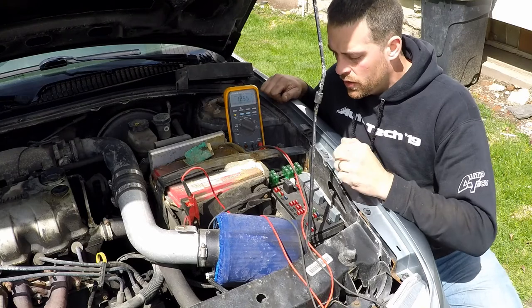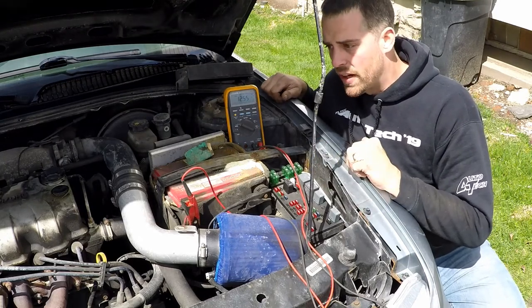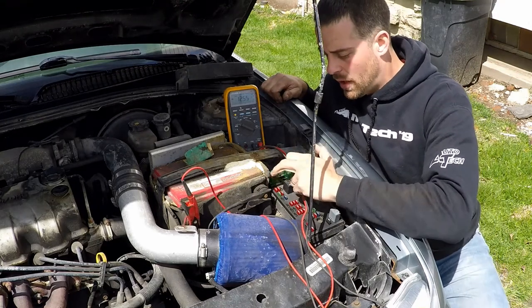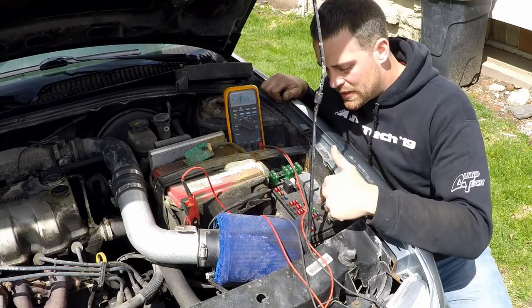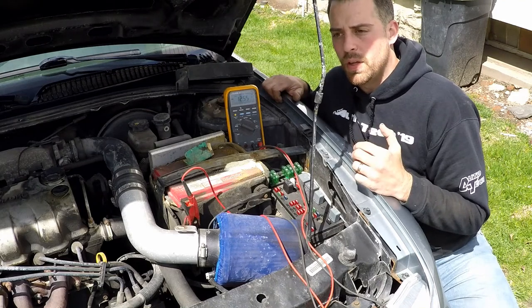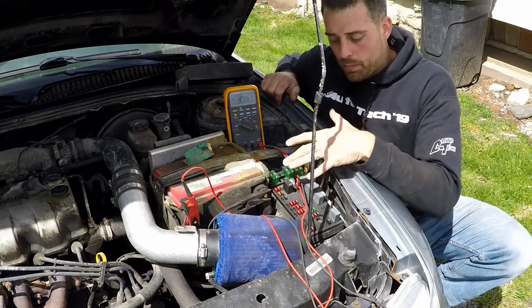So in our case here, we've got a fuse box, and we can use the information in the fuse block to help us out. We can look at the fuses. We can say we got a bunch of 30 amp fuses here, a whole bunch of 10s, 15s, another 30, a 25. There's a bunch of different circuits here that are being protected, and we can kind of estimate their output based on the rated fuse.